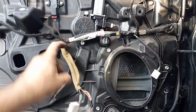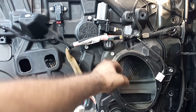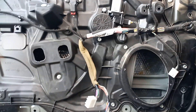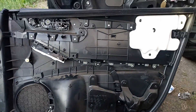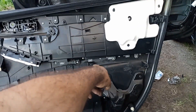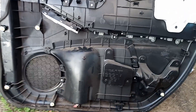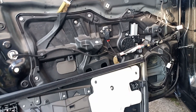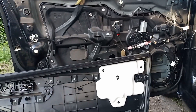For the soundproofing, maybe some spray foam on the back of the door panel might work better instead of all this stuff. Just spray it on the back of the panel since there's nothing there. If you wanted to put more sound deadening you can spray it - you just have the switch and the handle there, everything else is just plastic. That'll be easier: just spray it and be done with it. You do want to get the other panels in the back too, but that's it for the sound deadening on the Mazda 3. Now I've got to do it on all the other three doors.